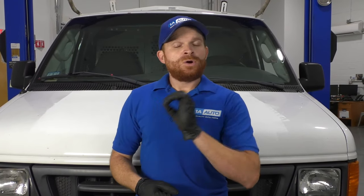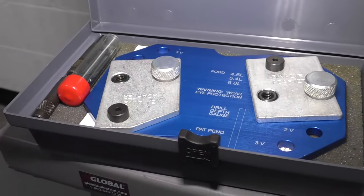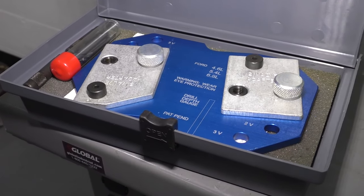When you're drilling, there's a very real possibility the drill bit could go off at an angle. If you drill into the engine, you could potentially damage it, or even worse, you might drill into your coolant jacket, which means you're going to have to replace that head. A special tool is available that makes all the stud holes line up so you can get them out perfectly. If you're going to be replacing two, why not replace them all — and of course replace the gasket at the same time.